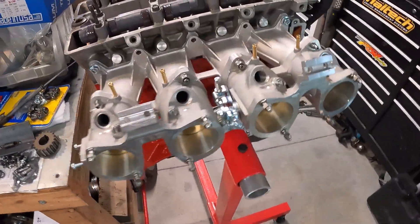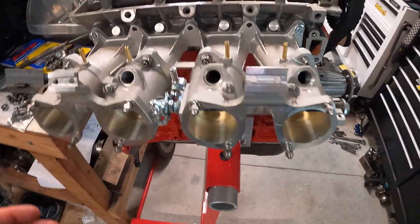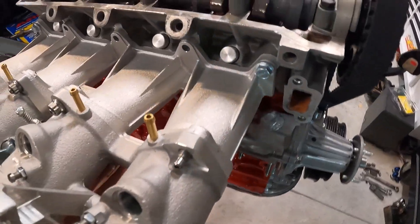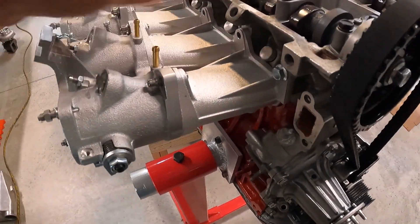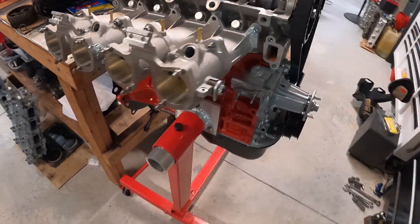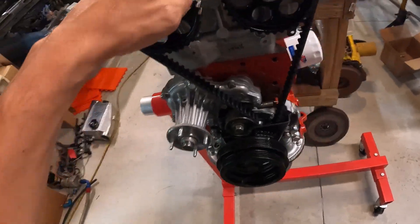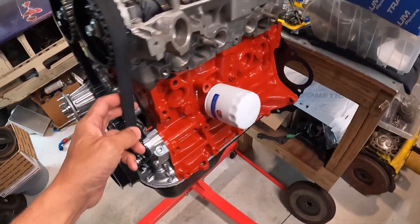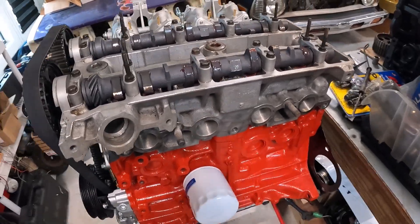Sorry I've been gone — there's a lot of projects going on around here. Let me show you guys this real quick: I've also pretty much finalized a 4AG build. I bought a Gen V style intake manifold with 48mm ITBs — probably the nicest ITBs for that engine. It's all assembled: timing belt on, cams in, valves lashed.